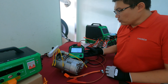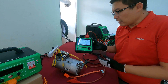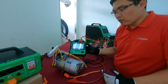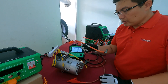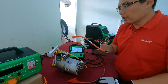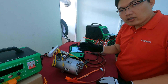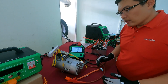Hello YouTube, today I will show you how to use the Launch ES200 isolation tester. Isolation is very important for high-voltage components inside the vehicle — inside the EV. Even just a wire, we need to check whether the isolation is good or fail. Not just cables, but also the aircon compressor or the EV battery — you need to check the isolation part by part.